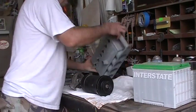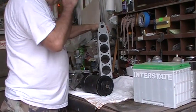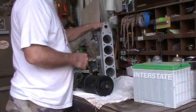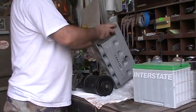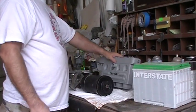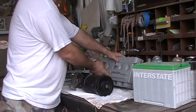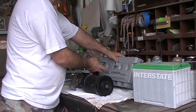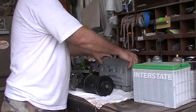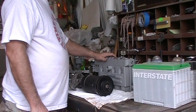There's a crankcase that fits on the bottom with all your crankshafts and all this other good stuff — pistons and everything. It's aluminum so it doesn't weigh much either. This is the 26 horsepower Crosley steel block. Later on they found out it would rust out on the inside where it was copper brazed. Somebody tried to fix the leak and it started failing. All the antifreeze at the time was salt-based, and that ate these things up easily.